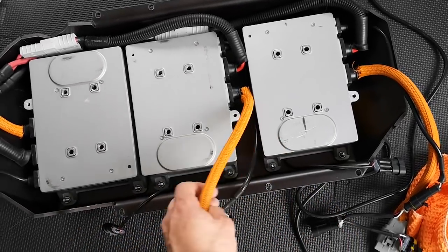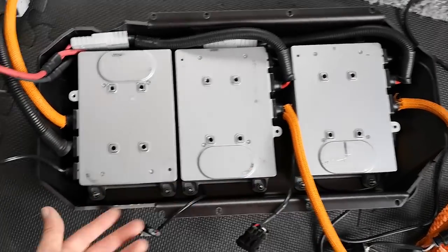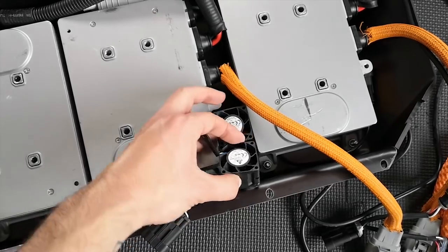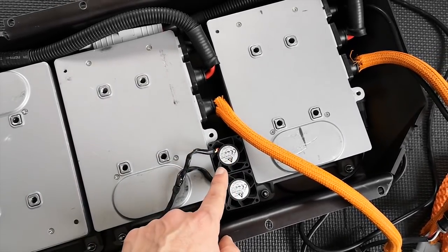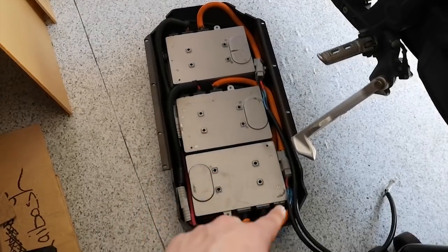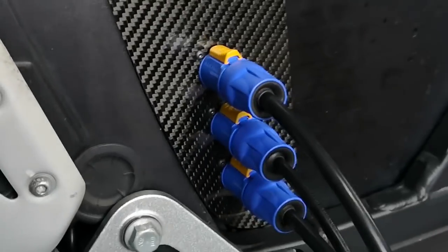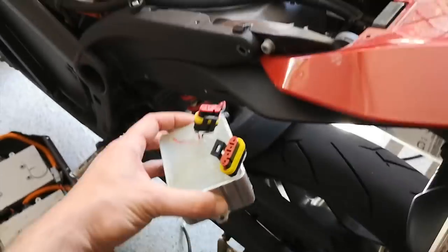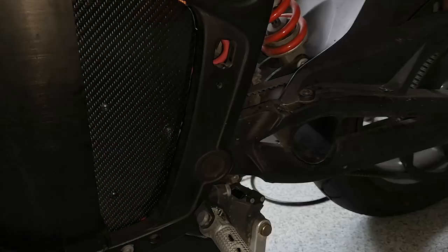Next up, we have to route the other side. Find all the fan cables and hide them really deep down, because there isn't really a place in this pan for fans — unless you have these little tiny ones. You could possibly mount them in here somewhere; they just barely fit. Two little fans — just make sure they're waterproof, because these ones are not. I have the AC on the right of the pan going to the Neutrik inlets, each one wired up individually so I can access each charger and connect as many as I want. On the left side of the pan I have the DC cables — one goes up to the controller and two go to the aux cable. I'll put the brain box up here in the space under the seat. To cover up all these cables and for symmetry's sake, I made another carbon fiber panel for this side. You can never have too much carbon fiber.